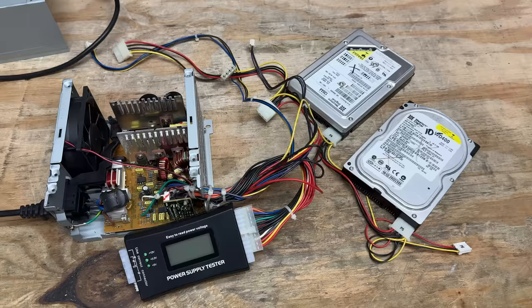Let's check out that CPU - there it is with the Cooler Master cooler on it. The fan sounds better than the last system. I'd say that thermal compound is gone. Let's see how that fan sounds - it doesn't sound too terrible, probably just needs a cleaning. Let's get that off. All clean now - let's get it back together.